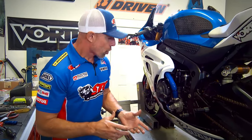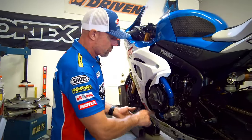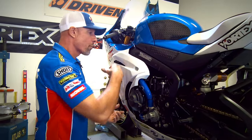You're also gonna find with the factory hoses, there are these Chinese finger trap looking things. Remember you used to get those in your Easter basket when you were a kid, at least I did, I'm really old. They're these bamboo things you put your fingers in and pull apart and it locks on your fingers. The OEM hoses have these protecting the hose, in areas where the hoses will be touching things that are hot, right? This lower hose, the upper hose, the small hose here, we detail all that as we go through the video. I chose to take those off the OEM hose and install them on the Samco hose kit. I would recommend that you do the same thing.